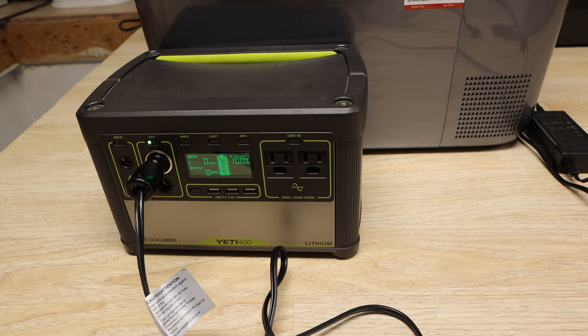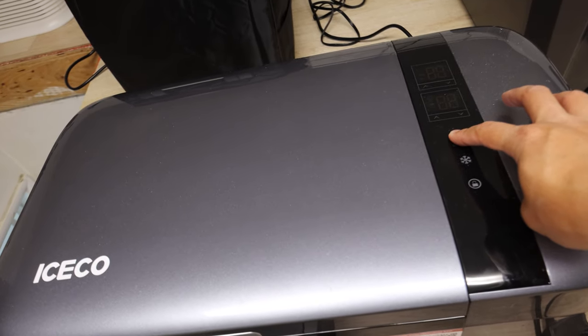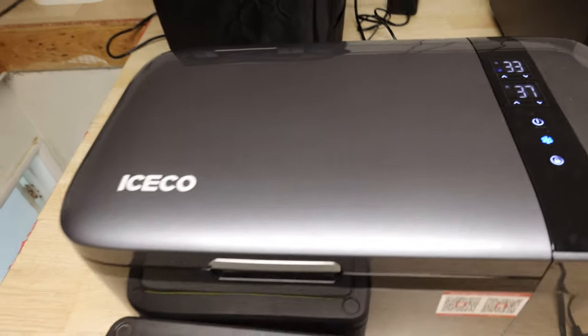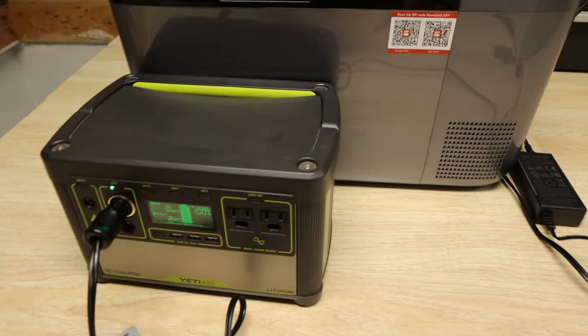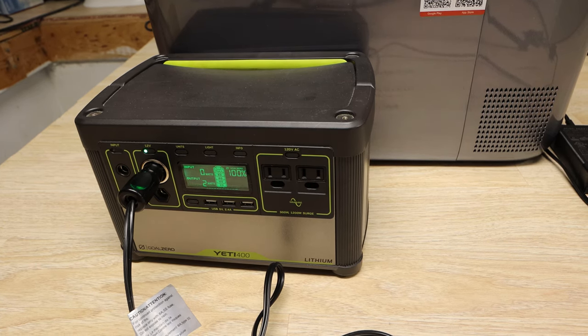Now I will turn on the fridge freezer so you can see how many watts it takes. I turned on the quick freeze so you know what the maximum wattage is. Right now it says 2 watts, but obviously it will kick up once the compressor turns on. 38, 36 — so you're roughly going to get from 30 to 40 watts when the compressor kicks on on this unit. Once it reaches temperature, the output would go back down to zero, and then as the temperature rises in the refrigerator again it would turn back on.